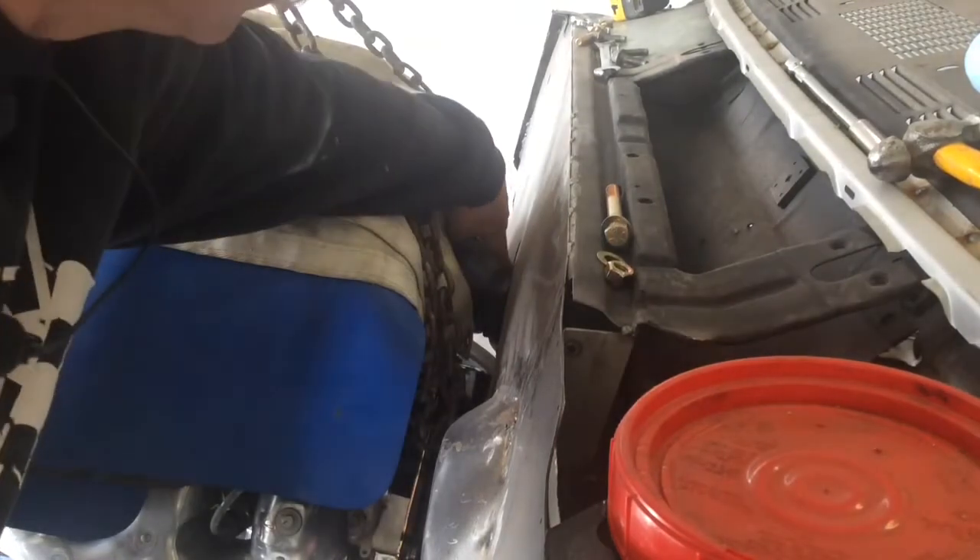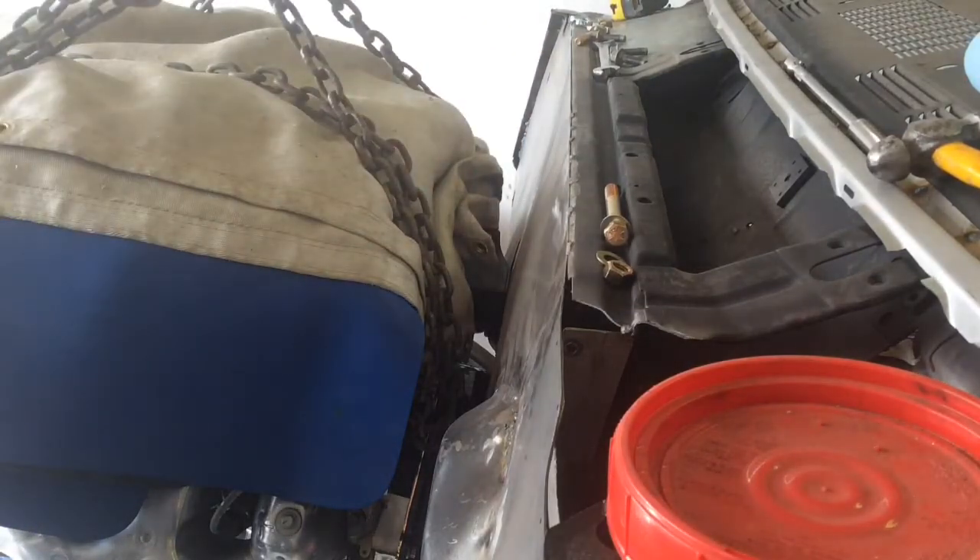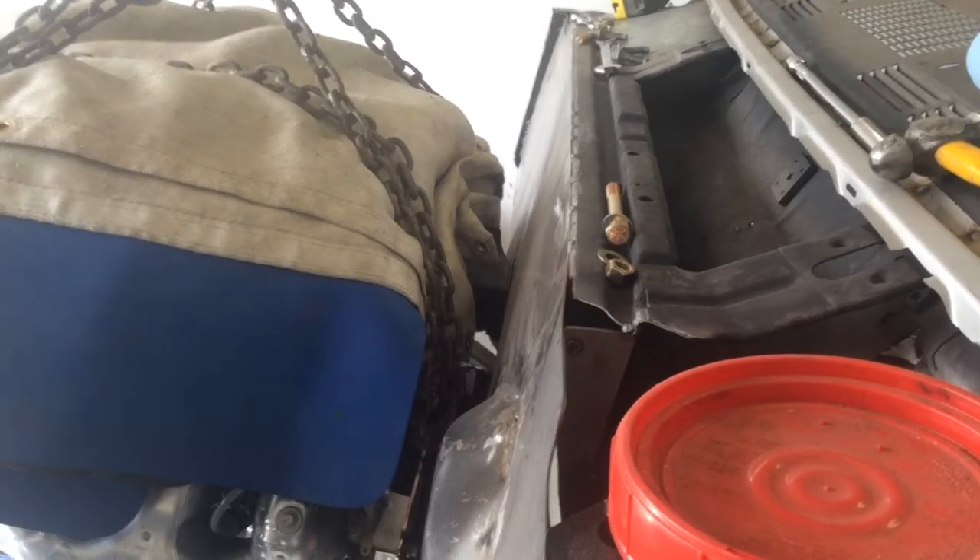You can see right back here the high pressure fuel pump. This is a foam cover for the pump, so there's about half an inch there. It's already just touching the firewall. We can get a half inch, but that doesn't get us the inch and a quarter to inch and a half we need on the shifter.